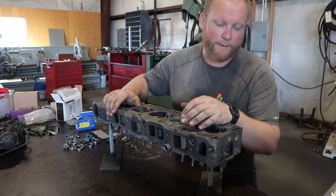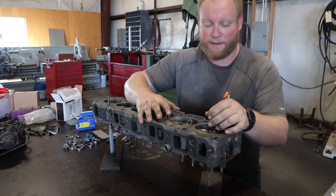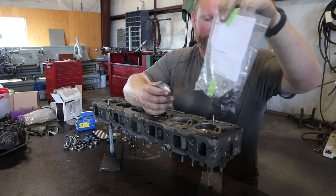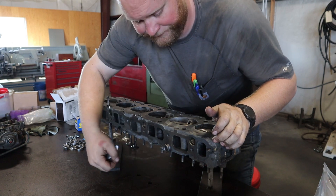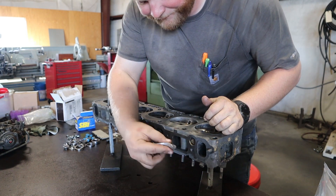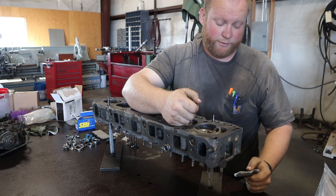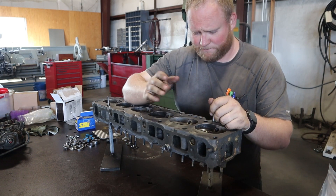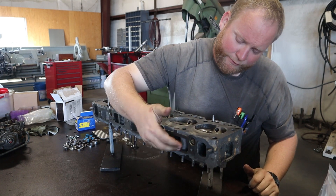There's going to be more stuff bolted on once we start assembling the motor, but for now I'm just focused on head modifications. We will be doing some head exhaust and intake porting. I've also got a bolt-in lump kit — it comes with a couple of lumps to put into the intake port. The idea is to create a nicer airflow for the air by reducing a really sharp corner in the intake, and it also blocks a lot of airflow. Everything we're doing is to create more airflow.